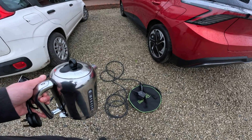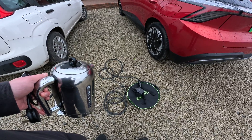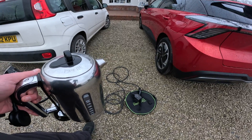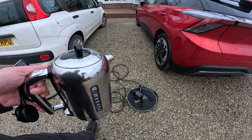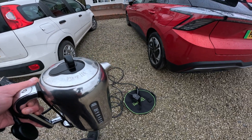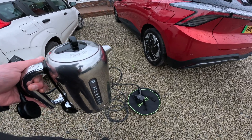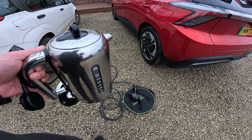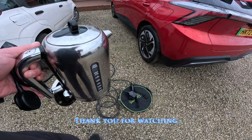I don't know how long it would produce that power for or whether you might overload it. I did hear of someone doing a test where they were actually putting out seven kilowatts from the charge port — obviously it can take seven kilowatts in, so it's possible it could output seven kilowatts. But I'd stay around the two kilowatt mark to be on the safe side for long periods of time; you wouldn't want to overheat any of the components in the car.